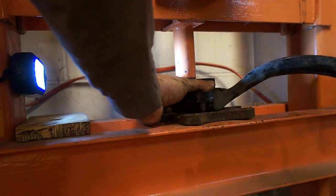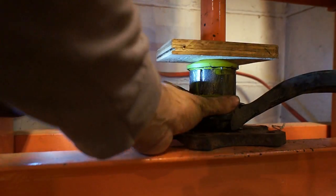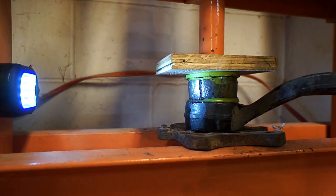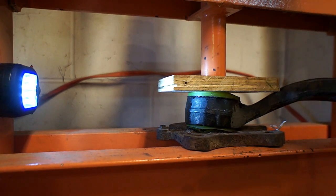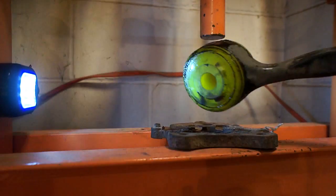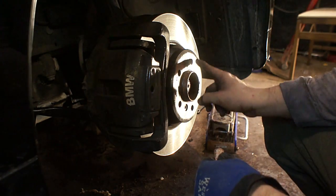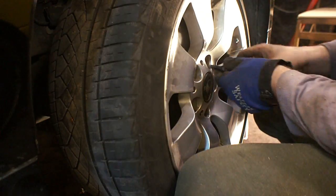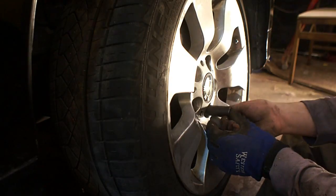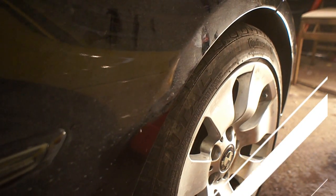The one thing everybody probably wants to know: did these end up squeaking? Polyurethane bushings are a little notorious for developing squeaks over time. I didn't publish this video right away partly because I wanted to see how they aged. I don't have the car anymore, but before I sold it they did develop a squeak — probably about nine months to a year in. I'm still friends with the current owner and he says the squeak has gone away. To re-lubricate them, you just take that one bolt out, drop them down, pop the metal sleeve out, re-lubricate, and put them back in. So if you're looking for something completely silent these might not be for you, but they really did make a huge difference in the feel of the car and I can recommend them. Thanks for watching — if you like this please like and subscribe, and I'll see you guys next time.